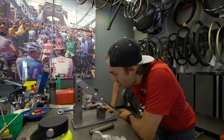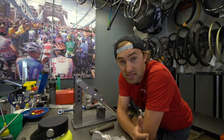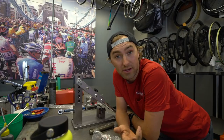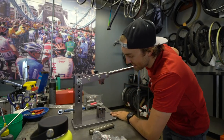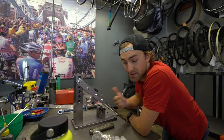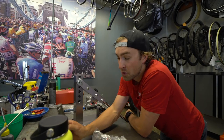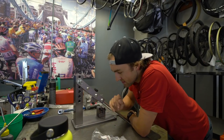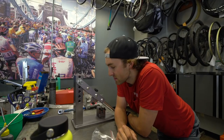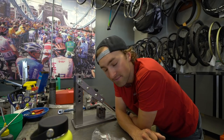What does that even mean? Well, basically what it means is that when a customer sends in a shock from out of state, or if I don't have the bike to work on, or also if I have the bike and I just want to make sure it's working properly — off with all the extra moving parts of the bicycle or after we do a service on it — we throw it in here and we can hand actuate what the shock's actually doing. Make sure all the compression circuits work, make sure the rebound actually speeds up or slows down with the correct adjusting knobs. Basically it's just the next cool toy I had to get. I was actually trying to design one of these and build one and get it CNC machined for a long time, but I don't have the knowledge or the tools to do so, so I ordered one. Handmade in Aptos, California. Keeping it in NorCal.